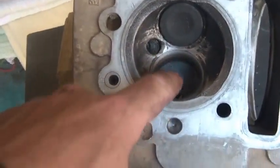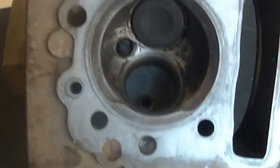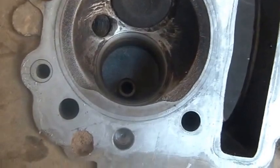The contact line stays right in center — doesn't crowd the inner or outer edge of the valve at any point. To me this means that when I seat this valve and put the spring back on, I should have a nice sealing valve. Once I do that, I'll take my little container, put some gas in it, hold it so gravity works on it, and spray some gas to see if it leaks. Right now it's looking really, really positive.